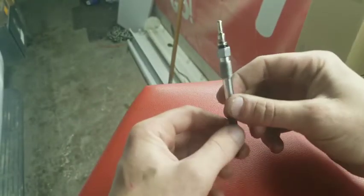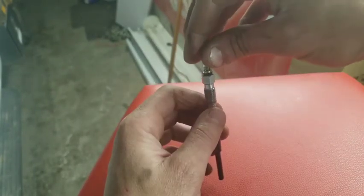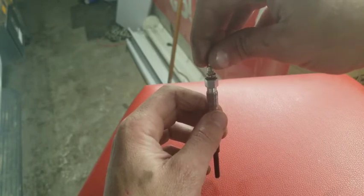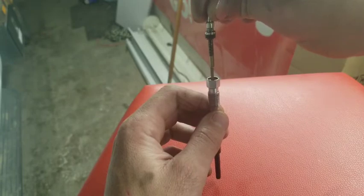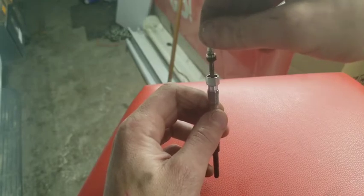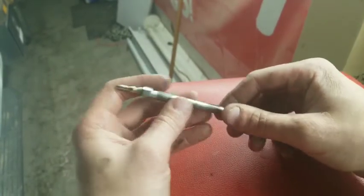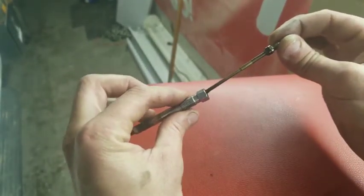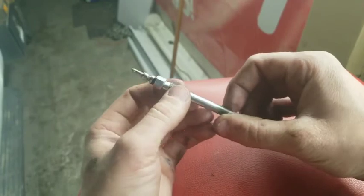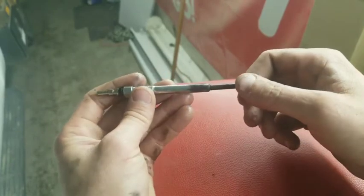All right, we got this thing out. This is how it's supposed to look. My very first thing I did was pull on the wiring plug that plugs on the back, and this just came out like that — eventually it kind of dropped in place. This part was loose. I don't know why it came apart unless it was just vibration, but the fact that it was loose means it was leaking compression right past through here.